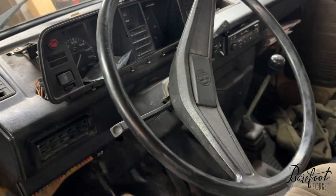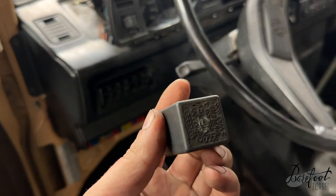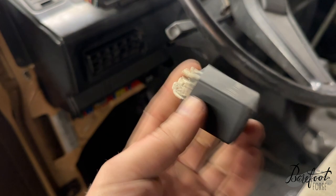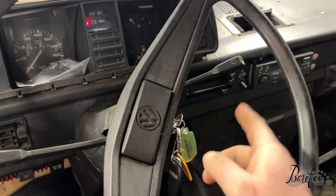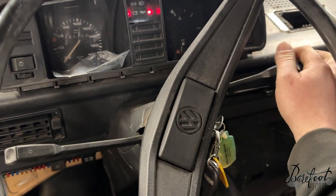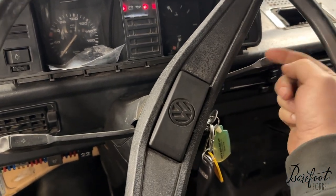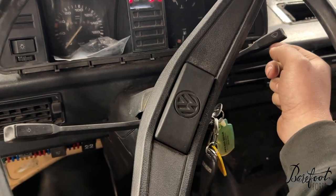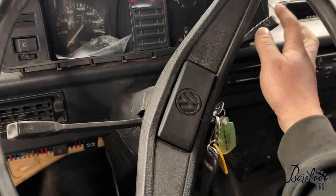The wipers don't seem to work right and I looked at the relays - there isn't even a wiper relay in there, so I can't believe they work at all. Let's put one of these in - maybe that fixes things. This has an even crappier windshield wiper setup than stock: the stalk doesn't go to the down position at all, so you can't put it in intermittent mode. You just have low speed and high speed - no other options.